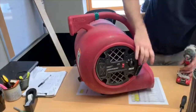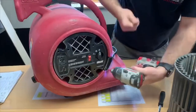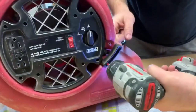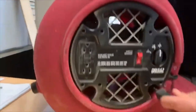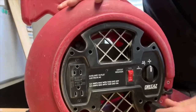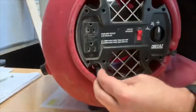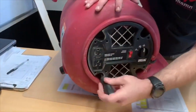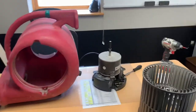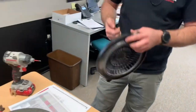To remove the motor and the cord holder, there are two screws. There are also 10-millimeter bolts holding the motor housing — there are four of those you need to remove. After the motor is removed, you have your housing now empty.